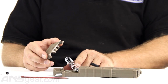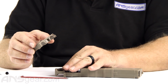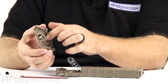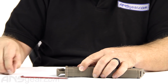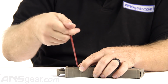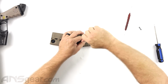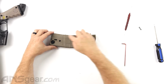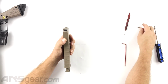It's going to sit like that. It's not going to lay nicely down in the little groove. It's going to sit up. So I'm going to make sure that it's positioned close. I'm going to put the spring into this groove on this side, and then just push it into place. You want to make sure that the spring fits that groove, and you don't want to pinch it anywhere, because when you go to turn this wheel and it starts pulling that string up and compressing that spring, if the spring can't move smoothly by itself, then it's going to have a problem.